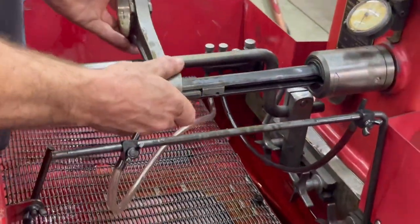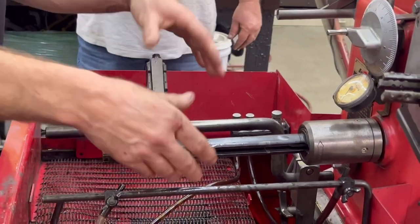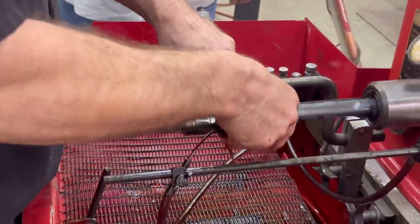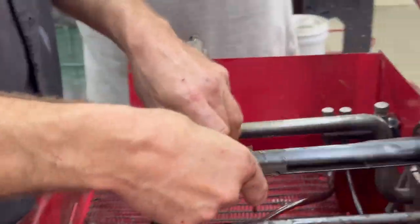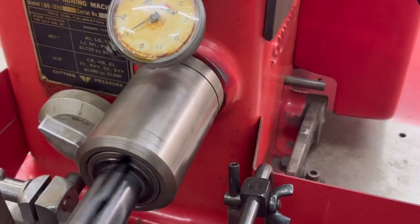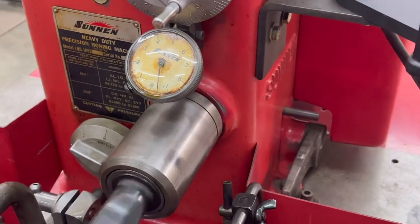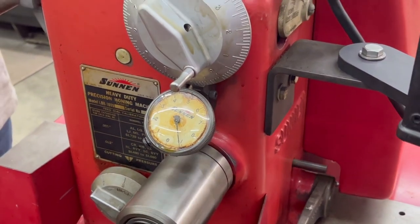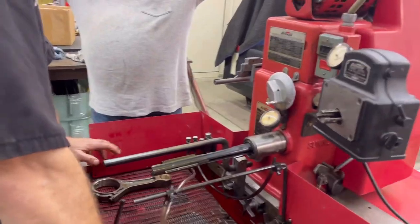Okay. Motor on. Coolant on. That's good. Coolant's working. Now look at this. See what it's doing? It's going down. That's because I'm removing material. So let's back it up a little bit more. Come on, stroke that bit. Don't sit there. See what it's doing? It's giving you an idea how much that feed rod has moved. Always get your foot off when you pull off. There's the ratio.